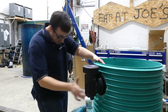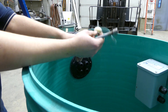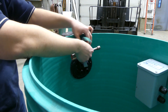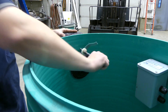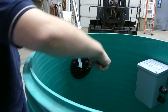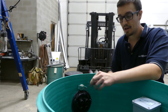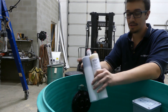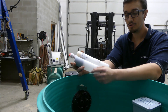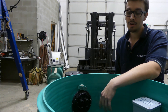We shove this in, and now we're ready to put that bolt in to hold it into place. We're ready to install the screw — more of a screw — right in this hole, and what that's going to do is keep that box from being able to fall out. That strap twirling around in there is just to hold your extra cables, so you've got a place to tie those up — definitely handy. One thing to remember when installing this bolt: before you install it, apply a little bit of methacrylic adhesive, because that's going to help prevent any moisture from getting in or out of the tank. This is available in larger tubes, which are less common, but we have the MA320 in smaller packages, which work great for this installation.